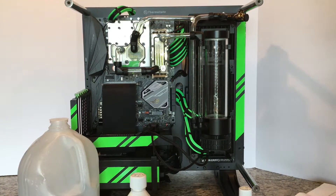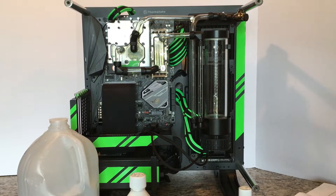After running your loop for about 12 to 24 hours, you drain it, then fill it with just regular distilled water and run it for 60 minutes, drain that, fill it again with distilled water, run it for another 60 minutes, drain that, run it for another 60 minutes, and drain that. I'll show you some footage of this entire process in later parts of this video, but for now I just wanted to introduce you to the second part of the system.